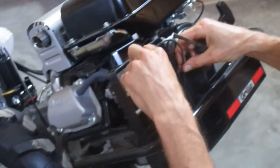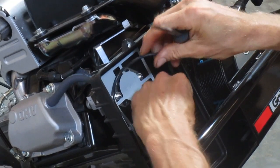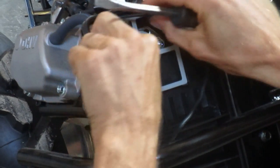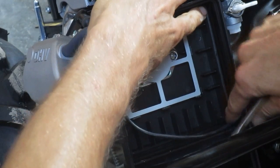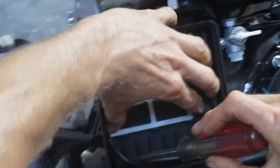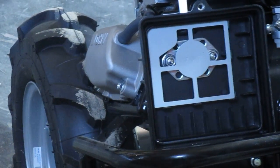The rubber seal is something you won't have to replace in the future unless you accidentally break it. It inserts at the base here, kind of around the perimeter of this enclosure. You want to get it tucked in there. You get it tucked in on the three corners and it's not quite long enough, so you just hold it in place, take your screwdriver, and stretch it out a little bit, and get it fully seated all the way around.